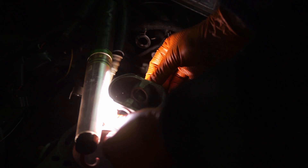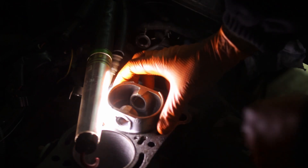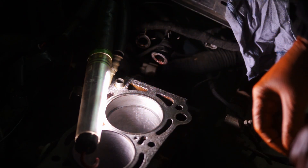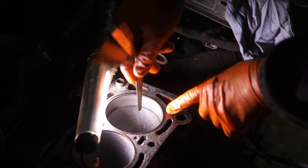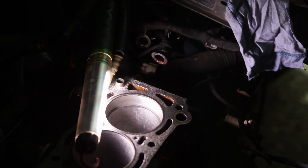Going about measuring it: I put it in the bore and measured about 0.4mm on the first ring and 0.3mm on the second ring. This would be within factory spec for the 4AGE 20-valve silver top and also black top, and that's similar to many other NA engines. Because I want to convert this engine to turbocharged I want a bit of a larger gap, so I'm going to widen that gap to 0.5mm and 0.4mm.